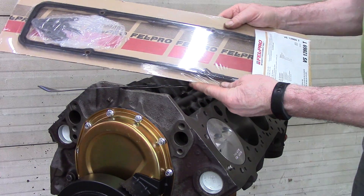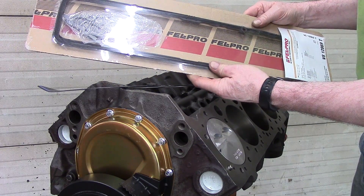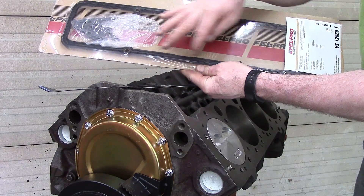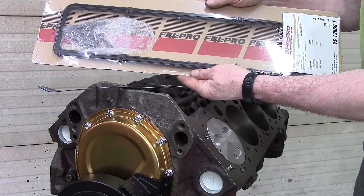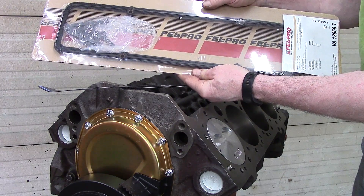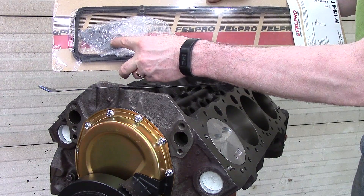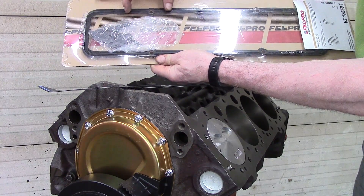While I'm on gaskets, I might as well touch on valve cover gaskets. Old small block Chevys with the cork gaskets just weren't worth a crap, especially with the four-bolt pattern and the old school stuff. If you're going to use a sheet metal valve cover, you need to use the supplied hold-downs, which spread out the clamping pattern for pulling it down tight rather than concentrating pressure in one spot.